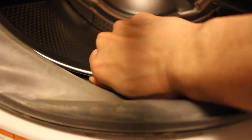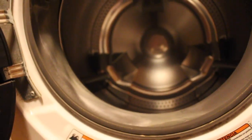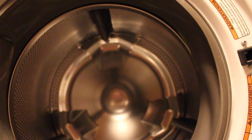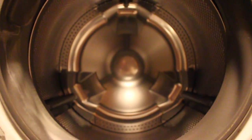This door is loose here, this stuff is deteriorating away, this drum here. I don't know if you can hear it, but you can't see it — it wiggles a lot. It's just like that water pump in that Ford truck — you can feel that play in the bearing. That's where my excessive vibration is coming from. When it does the spin, it vibrates so bad the whole entire housing just about breaks apart and shakes the whole damn house. I watched some YouTube videos and a guy told me to reach under here and see if the stainless steel basket wiggles — just wiggle it and it goes up and down. There is play in it, so the bearing's out.